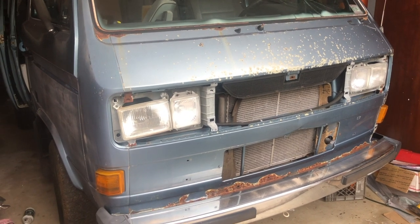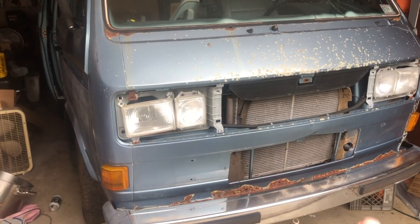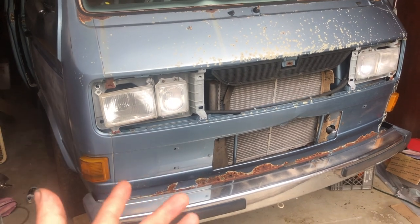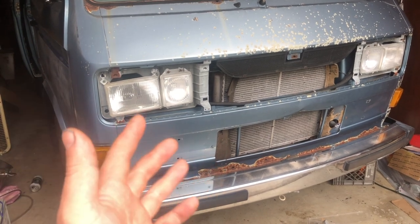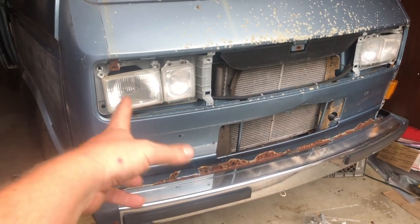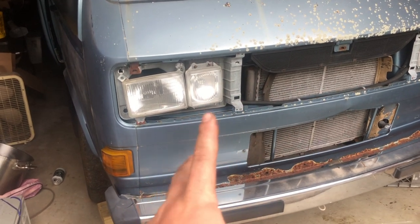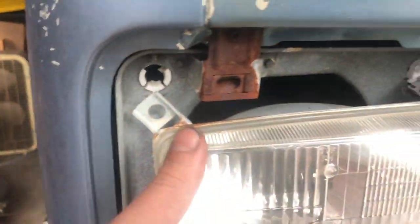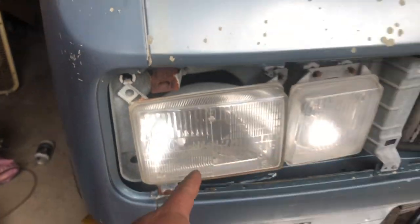Time to remove the square headlights. Square headlights came standard on all Vanagons from 1986 to 1991, but I hate them. They also just suck: there weren't any good upgrades, and they have US-market-only lenses that are absolute crap — the European models are way better. These don't project light very well. They also had crazy issues with the headlight adjusters that just kind of dissolve, and for a while you couldn't get those parts at all.